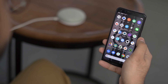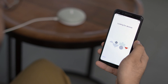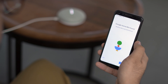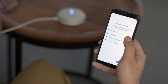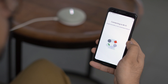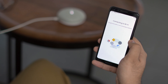Power on Google Home Mini and download the Google Home app on your smartphone. The app will automatically detect the Google Home Mini. If it doesn't, go to Devices and select 'Add Devices' and follow the on-screen instructions. Next, choose the room where your Google Home Mini will be located, then tap Next. Choose your home Wi-Fi and enter the password. You can further customize it by training the AI with your voice and address to get more personalized results.